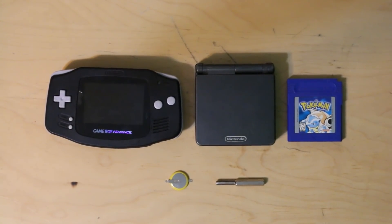I would not recommend going off and setting up a dummy battery because I've personally done that before and the wire was bad, which ended up screwing it up. Because if one of the wires are bad out of the two, then guess what happens? All your save data is gone. Also, if the internal battery is dead, which on both methods would actually ruin the save file, there are just a lot of variables with doing it that way.